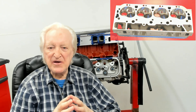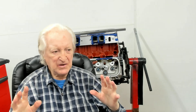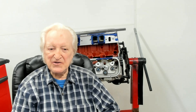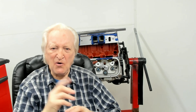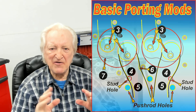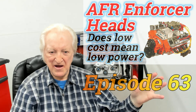Now the cylinder heads on this build — we didn't use the 280s; they're great for a 454, but what we did was use the Trick Flow 325cc port heads. I ported these myself. I have used them out of the box and they will make good power, but they port up very well and very easily. If you wanted to port some yourself, they're not very difficult. All the principles I've discussed about porting AFR big block heads apply to these heads in essence — they're very similar. By the time you've cut the port, you've actually got ports that are the same in each brand of head.